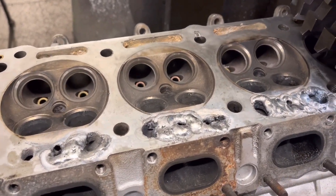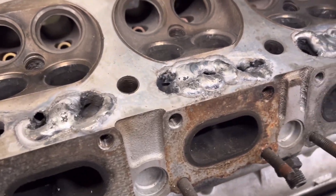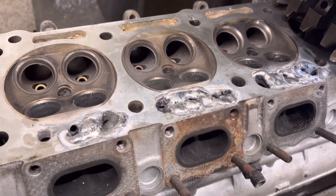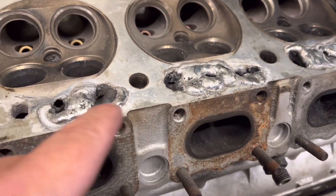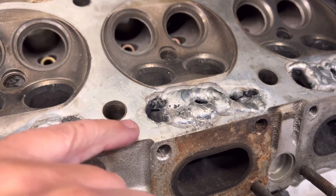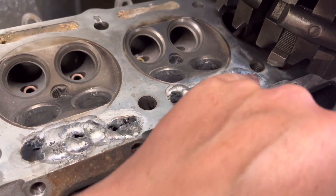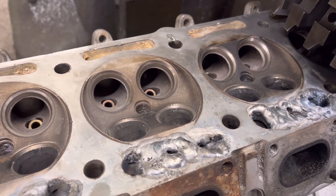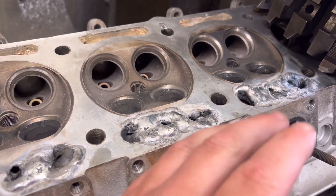Here's the head — don't be horrified. As you can see it's just really nasty. Mark actually ran out of gas on Friday so we haven't finished it. What I'll do is, because you can see all these black bits in here — that's all nastiness in the casting — we're just going to face this off right down to almost the face and see what it looks like under the surface. I think what we're going to have to do is build all this up. The problem is we can't really take hardly any more off this head, so with the heat and the weld it's going to distort it — it's borderline whether we can sort this out.